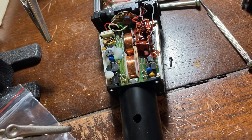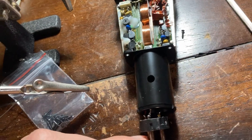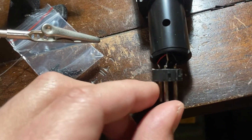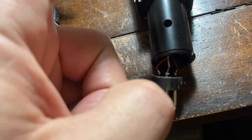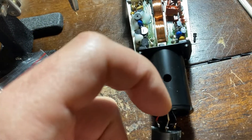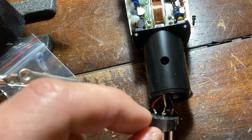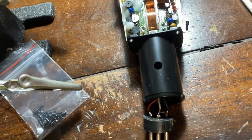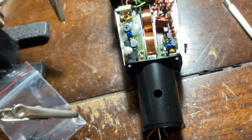The first thing that was tricky is basically the XLR jack — it comes from the bottom. You have to push it out from inside the frame, push down this way and it pops out. Then you have to desolder the three wires and make sure to put them back and solder them back in the right order.